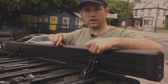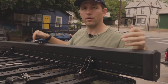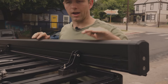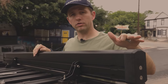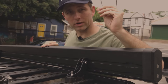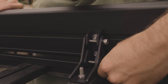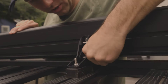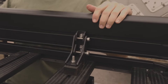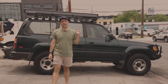Now that we've got all the hardware tightened down on the back of this profile and positioned exactly how we want it, we're going to set the angle. Based on the height of this vehicle, we decided that the neutral position is the best. We take the included hardware, find the middle hole, slot it so that it lines up all the way across, get it finger tight, then do the exact same on the other side, and tighten it all down.